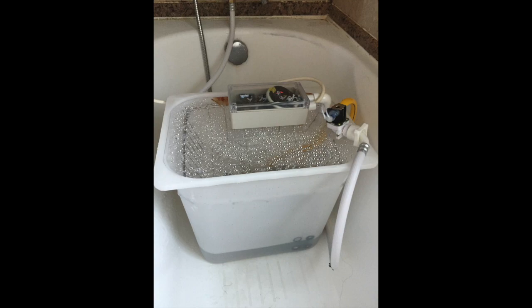The extra heat coming from the heater will be very high. It heats up the water, but if you don't have water and just dry-run the heater, it may burn up the box and cause a fire. So be extra careful dealing with the heater. This project can run without a heater — if you don't want to risk hurting yourself you can simply not apply the heater, just disconnect it and use the rest of the functions. It will still be able to clean the dishes. With the heater, oily residue is easily removed even without detergent; otherwise you need a detergent, and you can wash your dishes very clean.